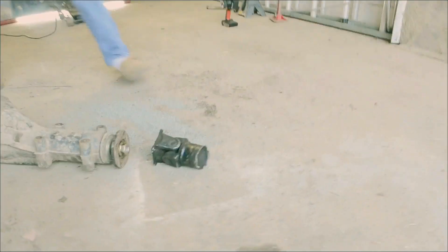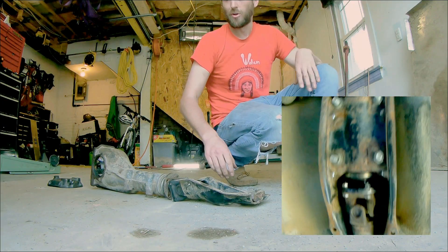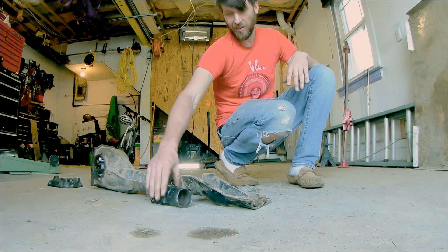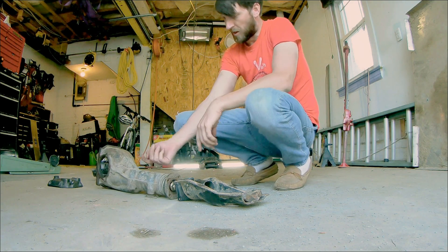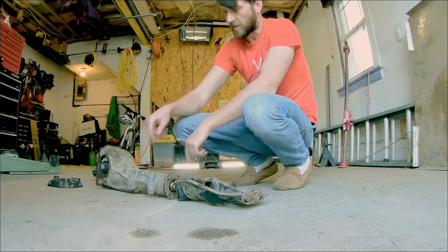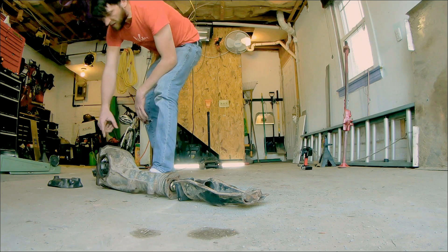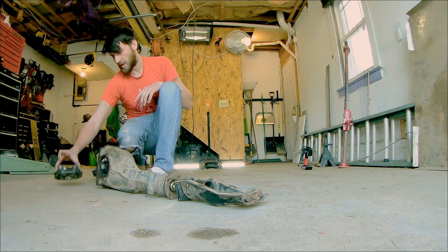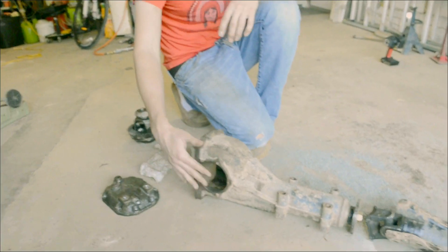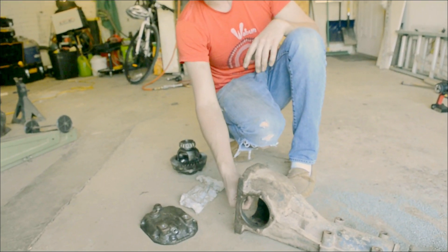There's a drive shaft protector over there usually on some models. This thing sits up under the drive shaft — you have to unbolt that to get access. You might be able to just get these undone and let the axle hang there. Then there are four bolts and a plate that goes up under here, bolted up to the crossmember and into the side of the crossmember. You have to take these four little bolts out and these four big bolts out. Then disconnect the axles — take these two studs out which will let this drop out of the back of the crossmember. Put a jack under there and lower it down, and once it's down low you just pop the axles out — they snap in, so you just pop them out.